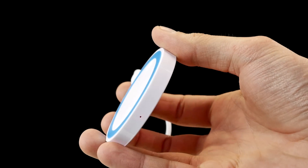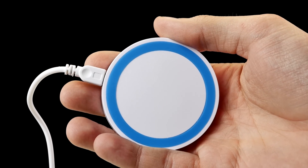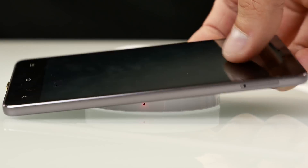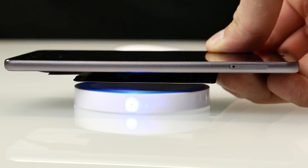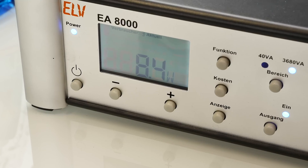So how do they look? Just like these small pads, diameter around 7 centimeters or so. They have a micro USB port and an LED which indicates if it's charging or not. So we've connected it to a USB port and here you can see the product. You grab your smartphone with the receiver — for instance here the Fly smartphone, the world's finest smartphone — and put it on the charger. You always have to find the correct spot, which can be a little tricky. The wireless charger has to be right under the receiver plate. The wireless charger is now drawing 7 watts from the power socket, and the output will be around 5 watts. As you can see, the LED indicates the device is charging, and it works pretty well.